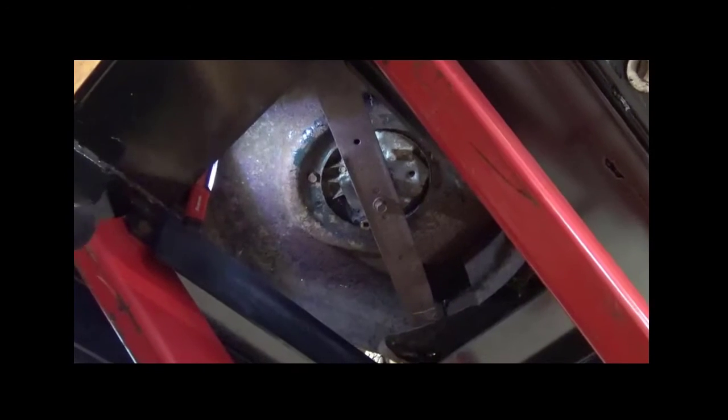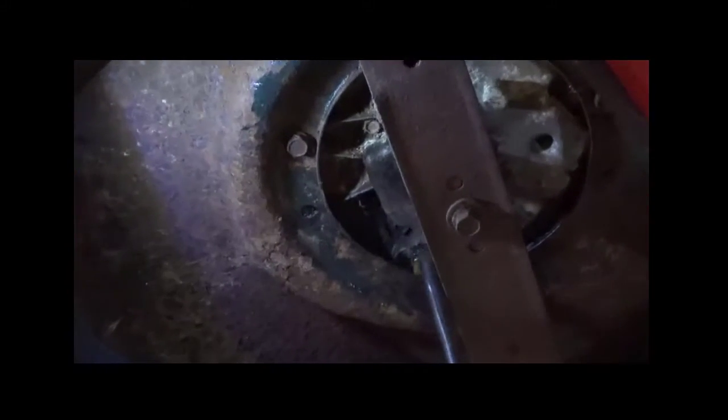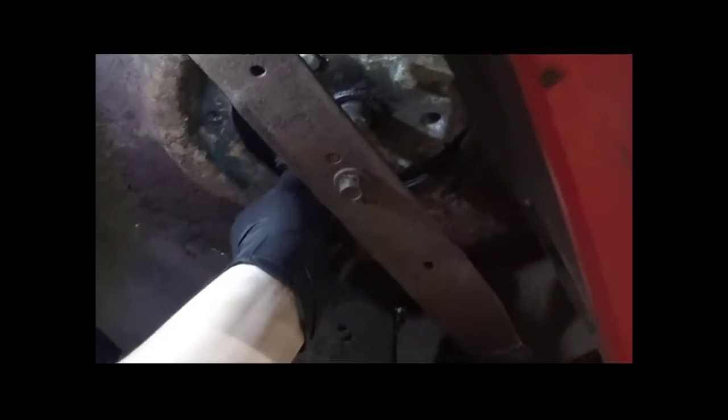To help take apart the engine and make it a little easier, I'm going to not only drain the oil but also take the mower engine off of the mower deck surface. Let's start by loosening this drain plug. I have a 3/8 ratchet and an extension - this extension just fits in there. I'm a big proponent of using extensions wherever possible because it helps keep your hands away from the work surface where you might hurt yourself. We've loosened it up - I'm only going to go about a turn or so. Now I need to get my drain pan in place to properly catch the oil. Okay, we've got the oil drained.